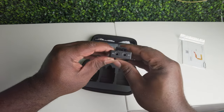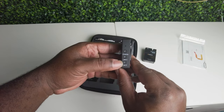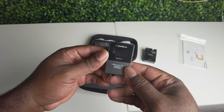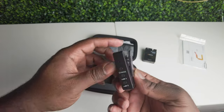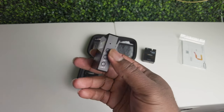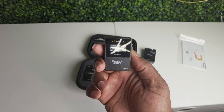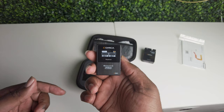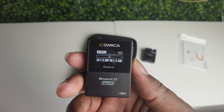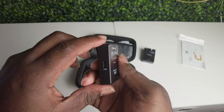Setting it to the side — the receiver has a monitor output jack and A and B volume controls. I was reading around and I think it has 12 different volume settings, but let me know in the comments if I'm wrong. Everything should be fully charged. There's a mono mode button, a stereo mode, and a safe mode. The safe mode records in mono but captures a separate track that's six decibels lower, just in case the original track is peaking or out of range — so you don't lose that audio.